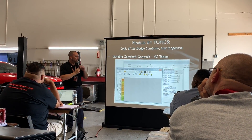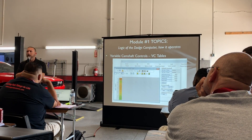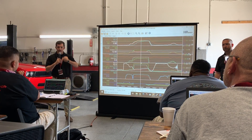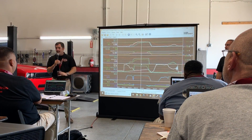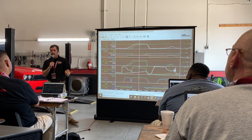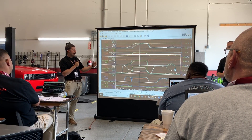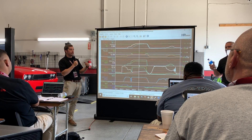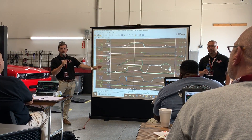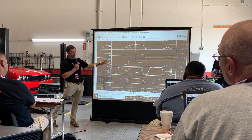Just take away from this what happens to the intake loads on the cam will happen to the exhaust loads as well, because they arrive at the same camshaft. When it comes down to torque, there is no strain gauge on the car measuring torque. The actual torque number is calculated - it's looking at a bunch of different things. The algorithm takes into account how much airflow there is, how much spark there is, how much fueling is being used, cam angle, and then it spits out a result - for example, we're making 425 foot-pounds. It then measures that against the expected torque from a table that says how much torque you should make.